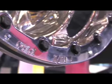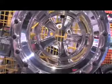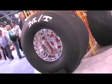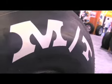Before the creation of this type of wheel, drag racers would have to actually drill holes into their wheel to hold their tire in place. They used wheel screws, which in some cases were okay, but they can be a safety hazard because you're penetrating the tire with a screw. With this wheel, you clamp the tire in place, giving you a high level of safety. The tire can't come off the wheel, and it also enhances the tire's ability to go forward on the car.